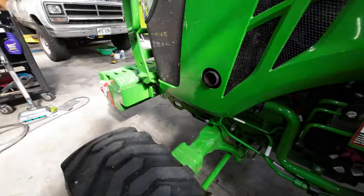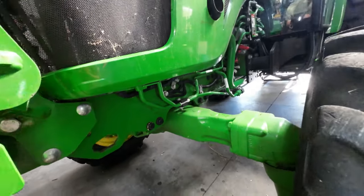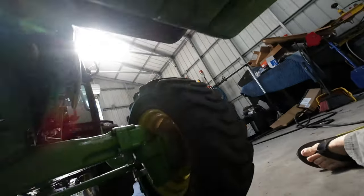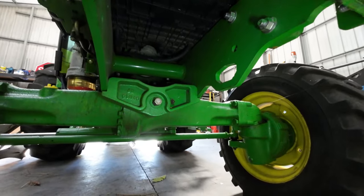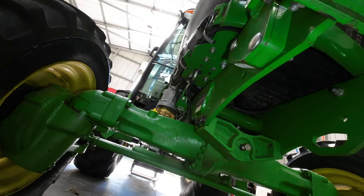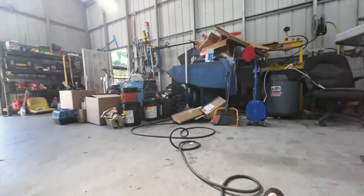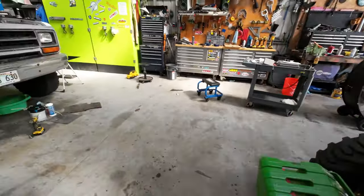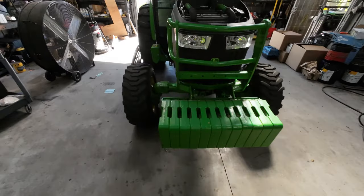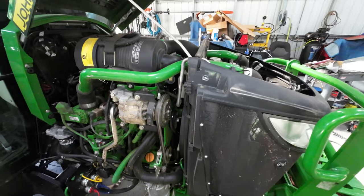As I've been reading around, these axles — I don't see anywhere that this is vented. Going underneath here, I do not see any vents of any kind. That little hose right there is for the coolant overflow, but yeah, these axles are not vented. So what I'm going to do is vent this thing. Really simple install instructions. Let's make a quick video of what I did and how I did it.